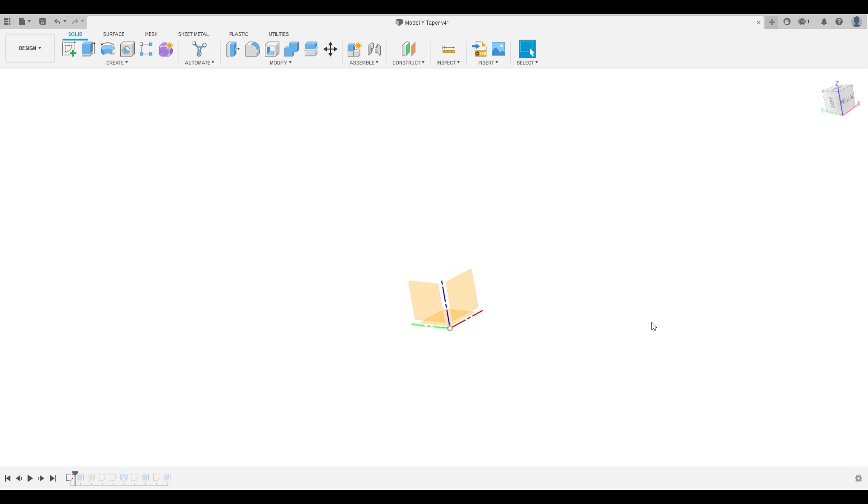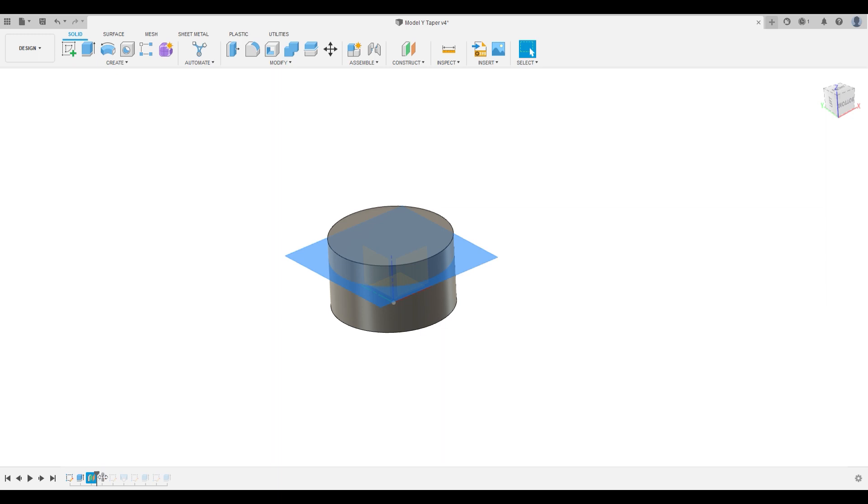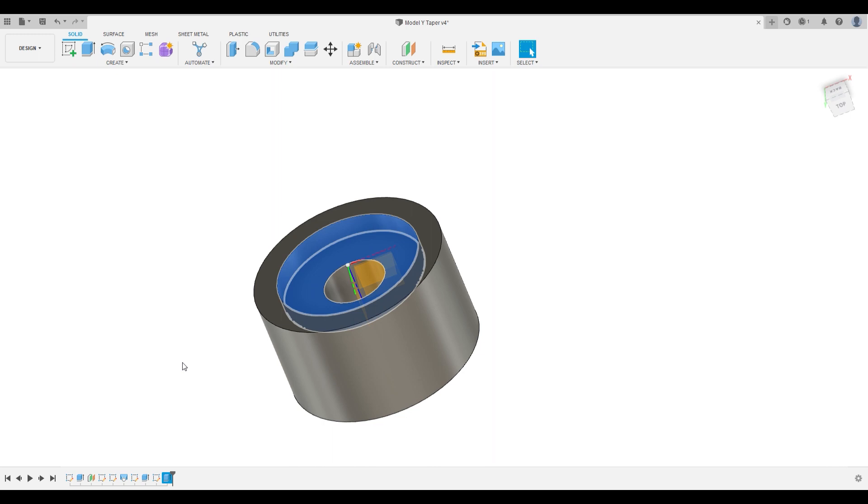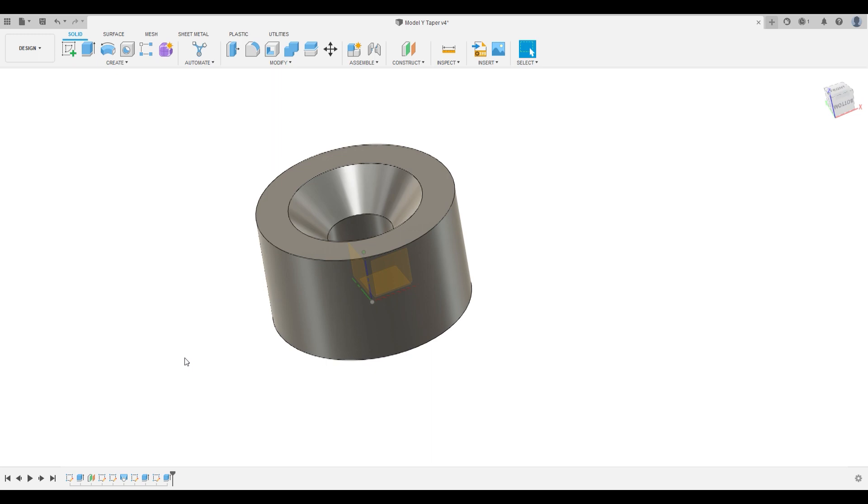Over into Fusion 360, we're just going to draw this part out real quick. The reason I ended up CNCing this part is because Tesla's taper is actually a very shallow taper with just a straight stud all the way through it — not any standard ball joint taper I could just manually machine out quickly. We draw a circle extruded out — this is two inch diameter, nice easy stock to work with. Then an offset plane, draw our two diameters for the taper, and a quick loft cut creates that taper shape. Next is a stud hole through it, and on the back side a relief cut for the nut to fit in. That's the very simple part drawn.